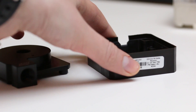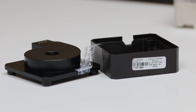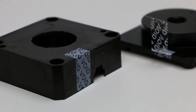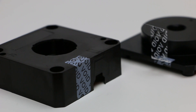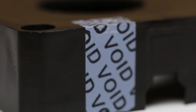The first step is removing the pump from its housing. There are four screws holding it in the top cover. Remove the pump from its housing, flip it over, and push on the center of the pump, which should free it — it's pretty easy. One thing to keep in mind is the direction of flow on the pump. I used the void warranty sticker placement in relation to the outlet as a mental note, but you might want to put a piece of masking tape on it as an indicator so you don't install the whole thing the wrong way.